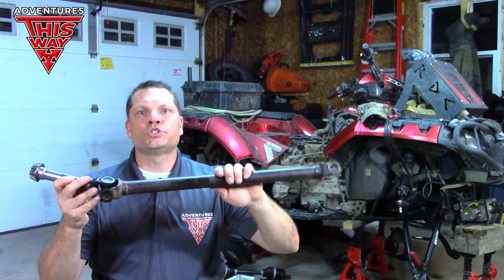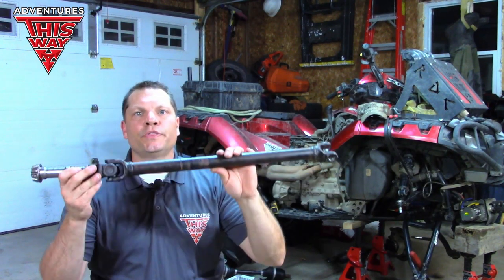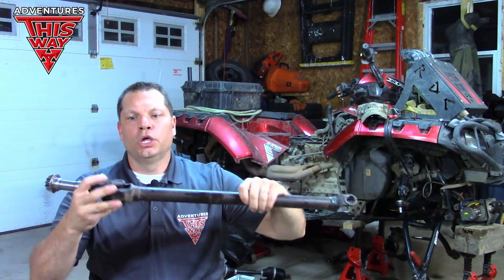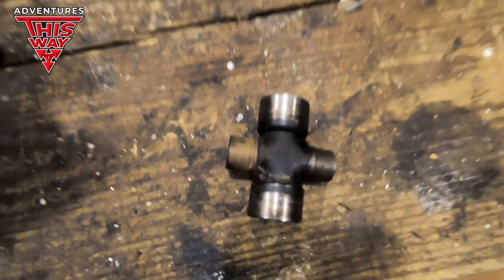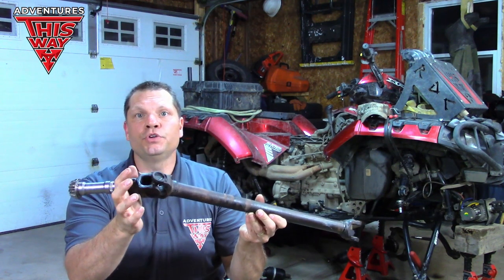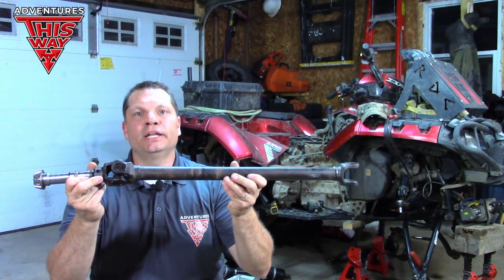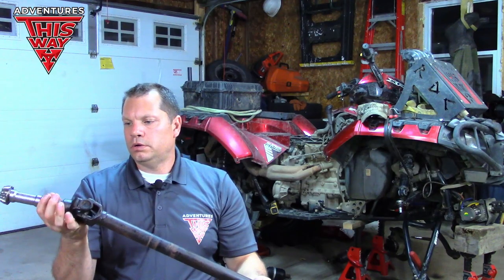Some of this may seem basic to more advanced folks, but there are so many people on forums and Facebook who are brand new to ATVing with no idea, so I wanted to explain this in more layman's terms. With the Polaris, every time the back wheels are turning, this is turning. So these U-joints — one here and this one I've already taken out — you need to inspect these. The biggest challenge is they are non-serviceable, which is fine if you don't go off-trail or get into water and mud. I'd highly recommend checking these for play as part of your regular fluid changes.